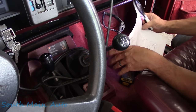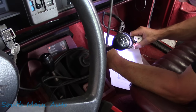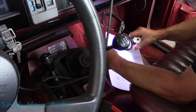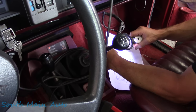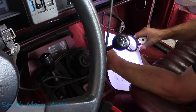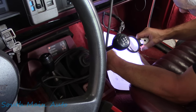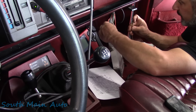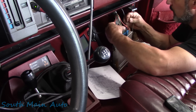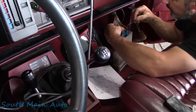And if both of those are steady, but the scan data is still screwed up and the car is still screwed up, then I'm not gonna bother testing everything else that's not functioning. So let me figure this out. I'll find out where everything is, and then we'll do some simple checks. There we go, MAP sensor in. Reference voltage. Let me get the right pins here. So this should be our power. So I'm just gonna probe into that.